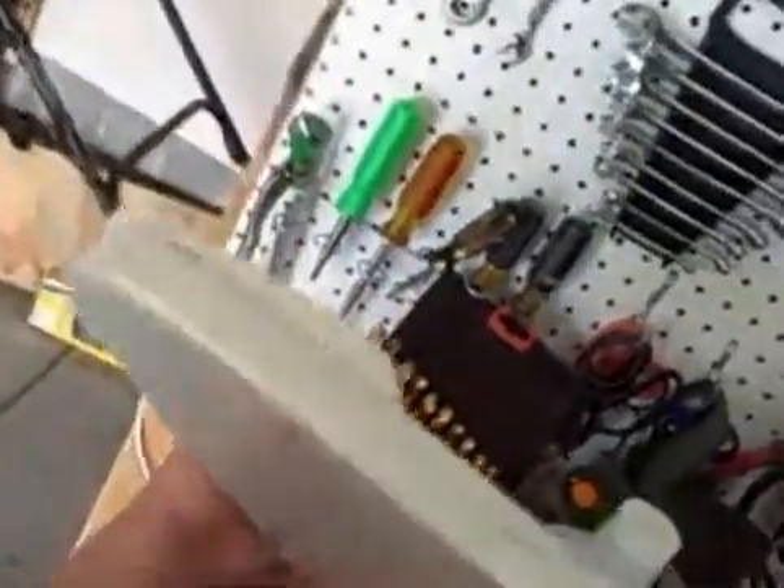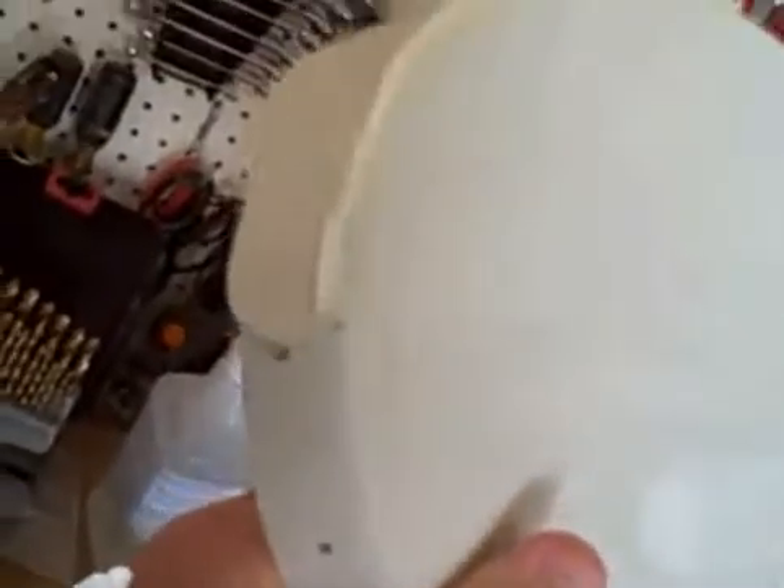The leading edge of this wing tip didn't fit that well. So what we did is put some micro balloons in there to help give it a little bit more area, so it sits flush up against the curvature of the outboard of the wing. I'll show you how we did that here in just a little bit.